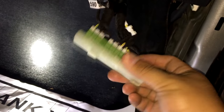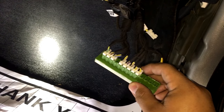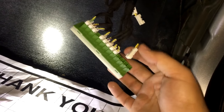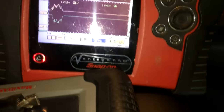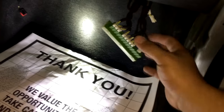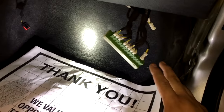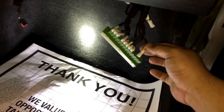I've already figured out the problem. This is the splice that's underneath the glove box on this vehicle. There are actually two splices for the CAN bus system — there's also one on the rear behind the passenger seat. This is the front connector. What I like to do is, if I see a signal that has glitching or noise, I come to the splice and start disconnecting these one at a time, isolating the modules and seeing which one fixes the problem — when I remove it from the connector, the problem goes away.